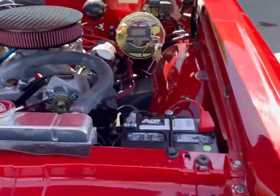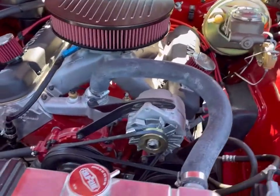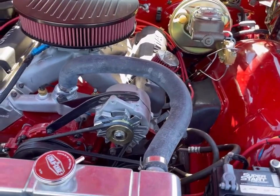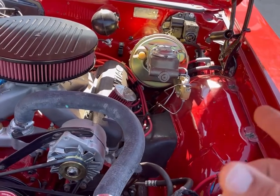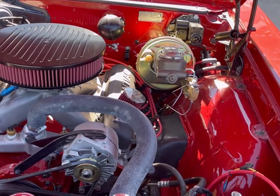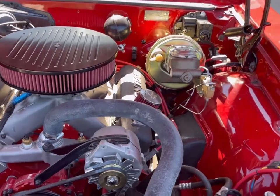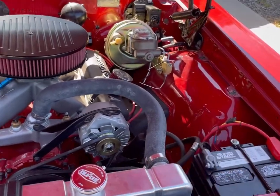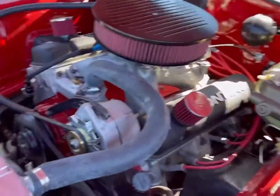I don't know if you've ever experienced this before. I'm sure you heard that if you put a big cam in your motor, the vacuum at idle goes way down, and then vacuum accessories don't function correctly. Well, what this will do is when you pull up to a stop sign, it'll work fine for like 2 seconds. And then you got to stomp on the brakes to get it to stop. So it kind of tricks you. It makes you think, oh, these brakes work great. And then they don't.